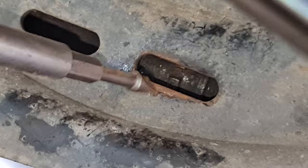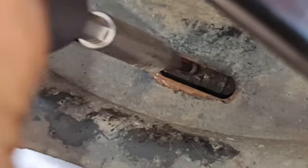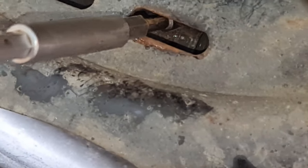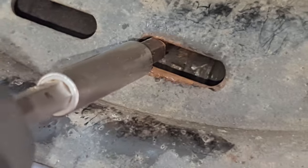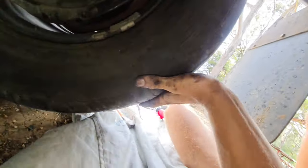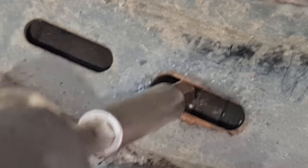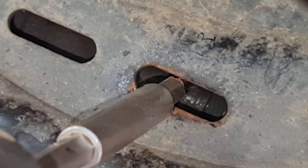So you want to kind of get it to that point, or maybe a little bit less. Just when you start feeling that resistance and then you want to back it off. By the way, if you can get a bigger screwdriver — like a flatter one — it'll make this a lot easier. So that's better — it's spinning, but it's still got resistance. You pretty much want to make it so it feels like it was before — coasting freely but you're so close to that resistance because you want it to be almost touching. So when you do brake, it only has to move a little bit so it doesn't shock the system.